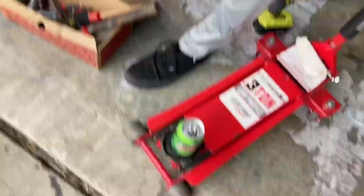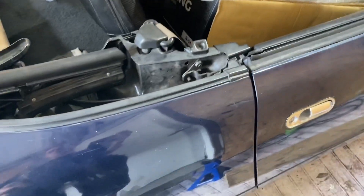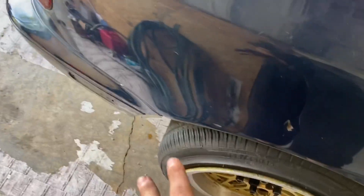She'll be getting noise. How low is this? It's really not that bad. I'm surprised - I thought they'd go a lot lower. The front's sitting up a little bit high because it's on coil load. The rears definitely need to go down. We're way lower in the rear. We got to go down a little bit more. We basically need to full slam the coilovers - with all the collars on them, without messing with preload or anything. So this is as low as the extreme lows can go without taking stuff out.